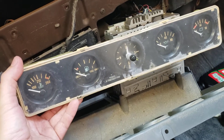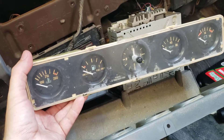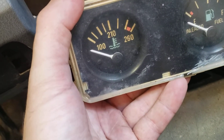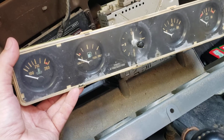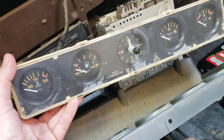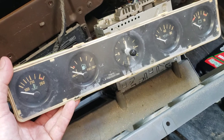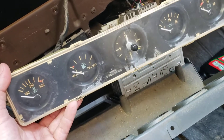One of the classic things for simple old school systems like this — where instead of a light you've got gauges — is to test for it, and it's easy with your temperature or oil pressure. Go under the hood and find what they call the sender. It's just a little variable resistance thing that takes the temperature or oil pressure and puts a variable resistance on the signal coming from these gauges.